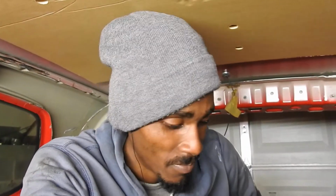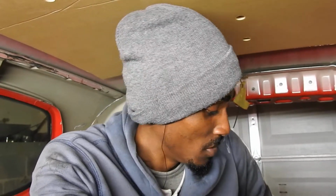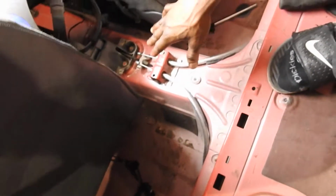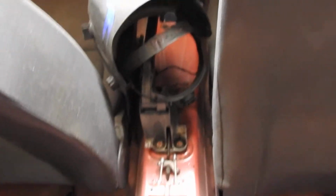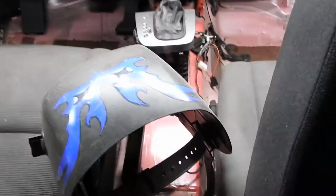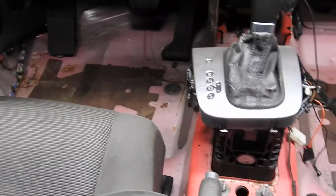It's coming along. We could almost lift the back of the car already. Little by little, it's coming along. So I gotta get a spot weld removing tool, so I could go ahead and start removing the little stuff that we gotta remove over here. Some part of this is double skin. I'm gonna see if I can remove some of it. It goes right down the whole tunnel, so I'm gonna see if we could get that done. And there's a lot of stuff we gotta remove down there, as you can see.